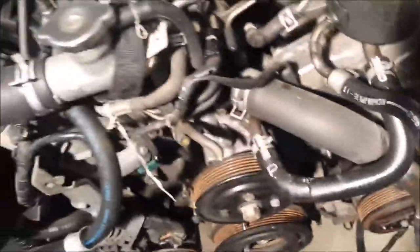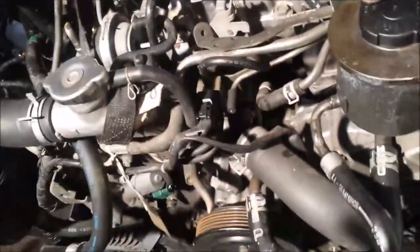Moving to fuel: I don't have the fuel rails, but the injectors are all the same part numbers — nothing changes there. The coil packs are the same, spark plugs are the same. I've actually been saving coil packs, so if you need coil packs or something like that, give me a shout. Coil packs, spark plugs — all similar. Let's talk about the ignition and fuel system, and I'll come back to the air system later because that's a major one.